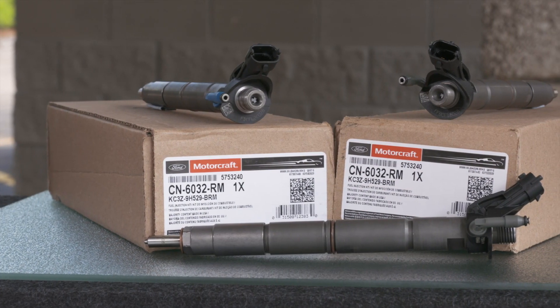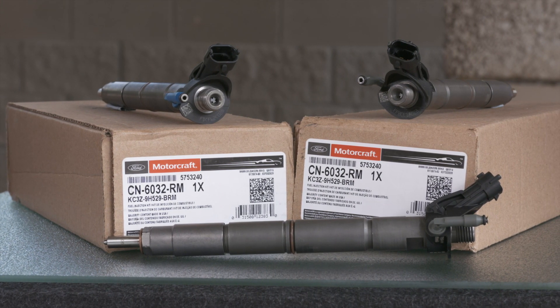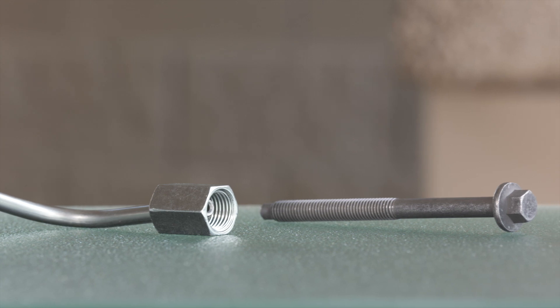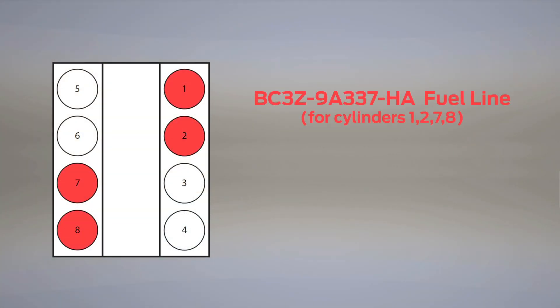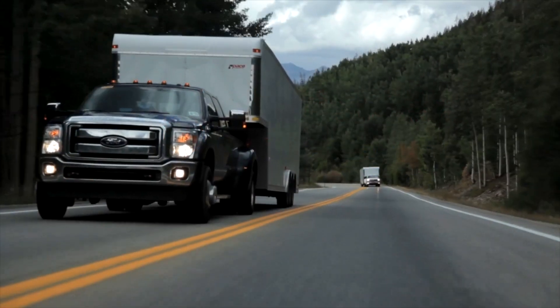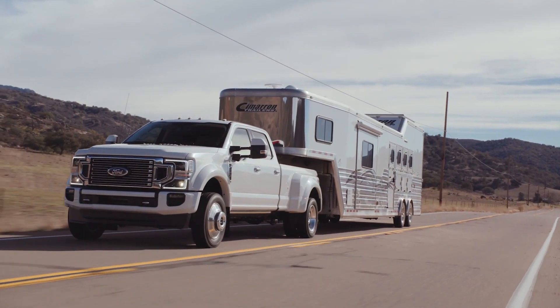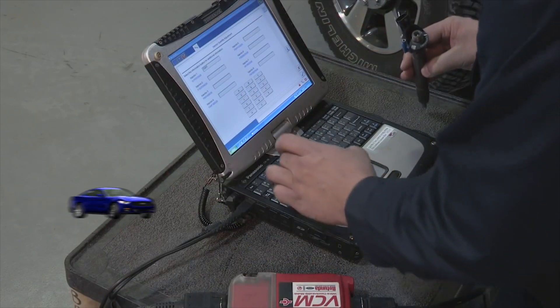One thing to remember: when you replace a fuel injector with a Motorcraft reman part, the fuel lines will need to be replaced too. You'll also need to purchase a new fuel line and bolt with the reman injector. There are two fuel line part numbers — the numbers correspond to different cylinder numbers, so you'll need to take note of the cylinder number when ordering to make sure you're getting the correct parts. If you're interested in learning more about 6.7-liter fuel injection installation, we covered that information in a previous Tech Talk, where we talked about the need to program each one individually during installation. You can find a link to that post in the video description below.